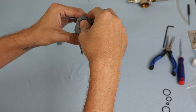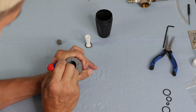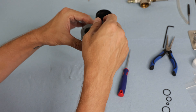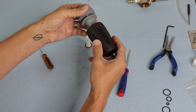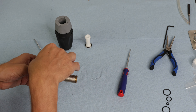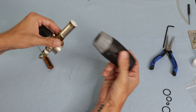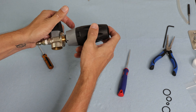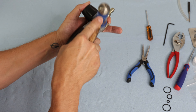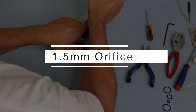Reinstall the adapter with the seal ring side down, push it into place using your finger, then use a flathead screwdriver to make sure it's fully seated. Do the same with the new filter. Then put the baffle back on the knob and make sure both clips snap into place. Next is the white plastic insert with a seal ring on the outside — slide the baffle assembly onto the body, make sure it's fully seated, and tap the pin back into place.